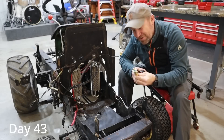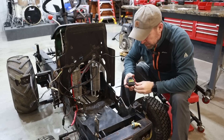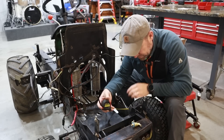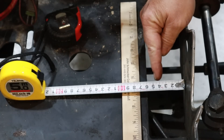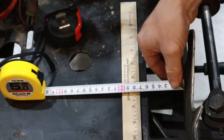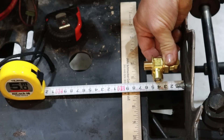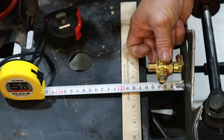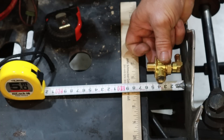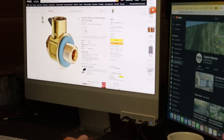Day 43. It's another slow day in terms of activity, but I want to get this valve situation sorted out. Trying to figure out how much room I have to see if I can get an extension on this. The edge of the engine block — the face of the threads — would be about at the 20 millimeter mark, so if I threaded it in that would be about where it sits right now. It really doesn't have room for hardly any extension. If I could get like a five millimeter extension that would be the maximum. Probably not a good idea to stack gaskets.